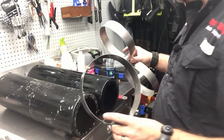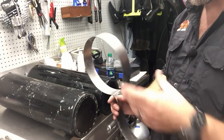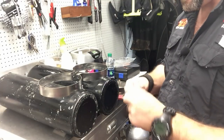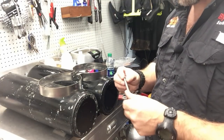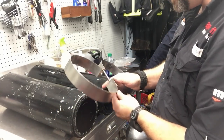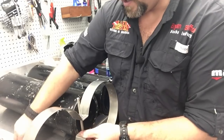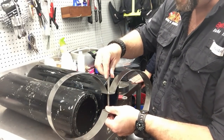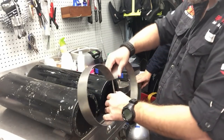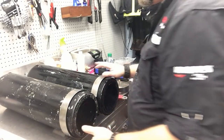I've got them marked both top and bottom. Mostly bands are always going to be the same so it doesn't really matter which goes on top or bottom, however they've formed to these cylinders because they've been on for a while, so I'm going to put them back in the order they were. To get started, I'm going to thread some hardware onto the band because it's easier to do it now - I shove the bolt up through the bottom of the band, add a washer and a lock washer, then place the nut on top but don't tighten it all the way down.